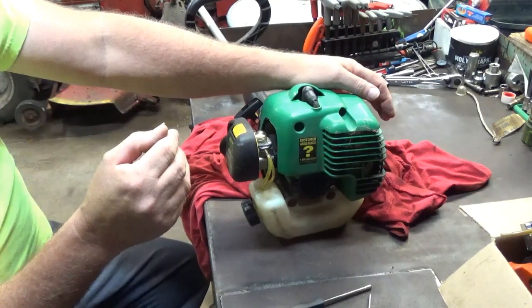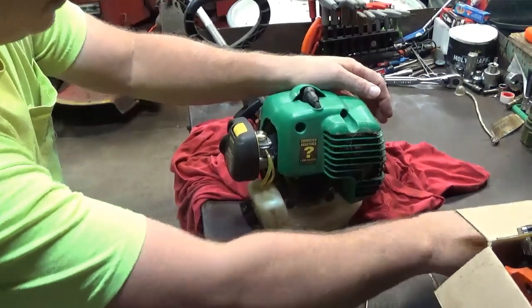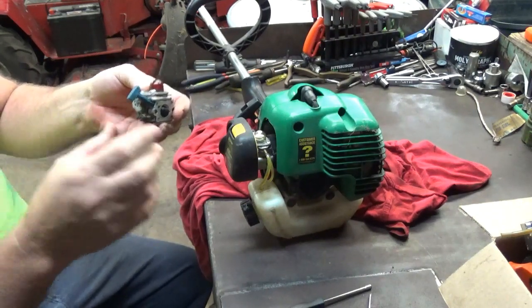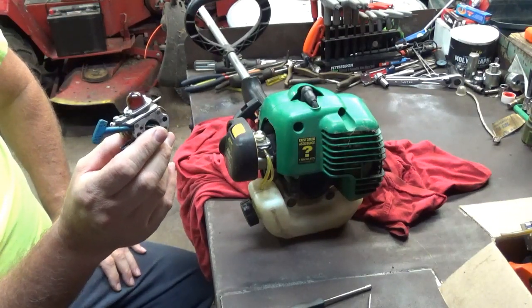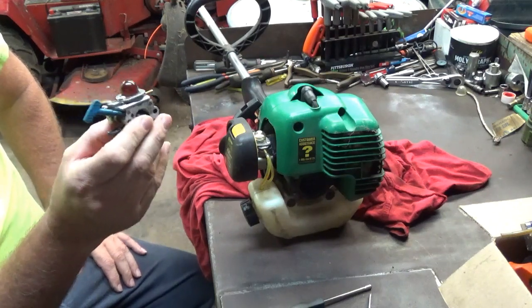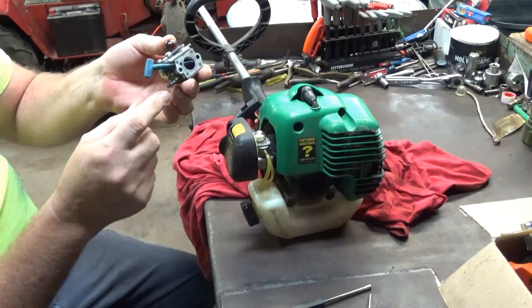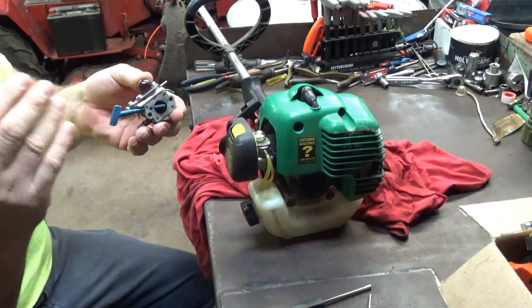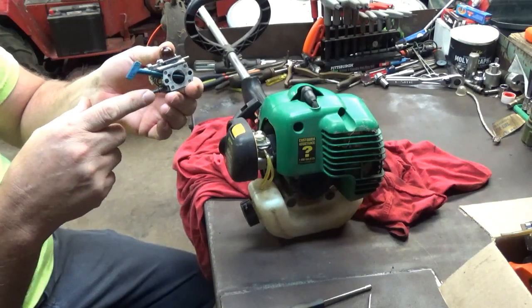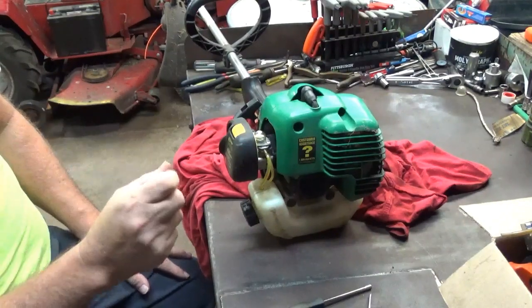But like I said, when you're adjusting the high, you pull it wide open, full throttle, and you open your high jet, which is the one closest to the choke butterfly. You open your high jet up until it starts to what's termed four-stroking, which is nothing more than a miss. It's a stutter, a miss. It'll start chugging, so to say, and that's the four-stroking you're looking for. Once you find that four-stroking, that stuttering or whatever you want to call it, turn your high jet back in until it smooths out and starts running at an elevated RPM. Once you find that nice smooth RPM, then open your high side jet back up 1/8 to 1/4 of a turn, or until it starts to chug just a smidgen. Once it starts to chug just a smidge, that's where you want to be.